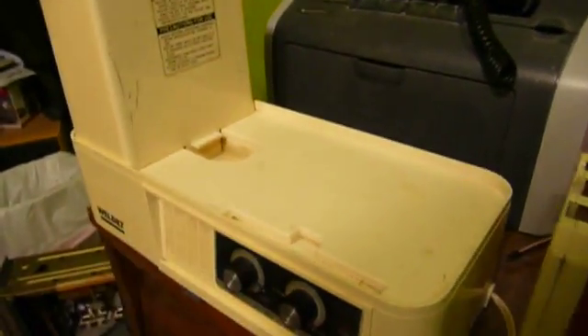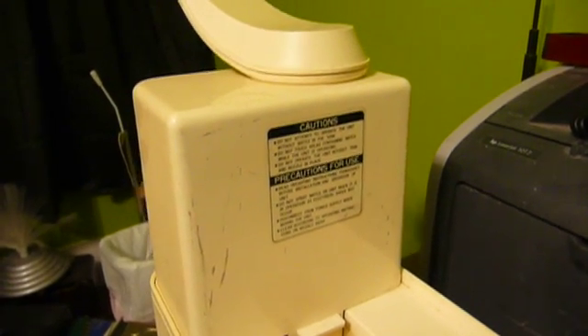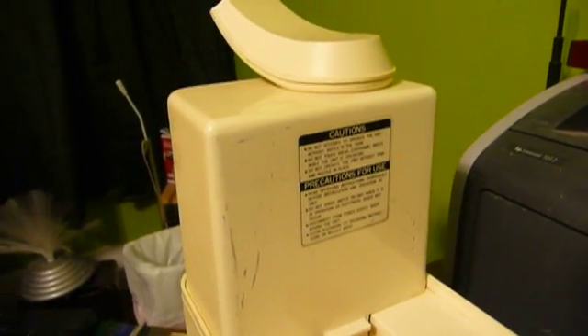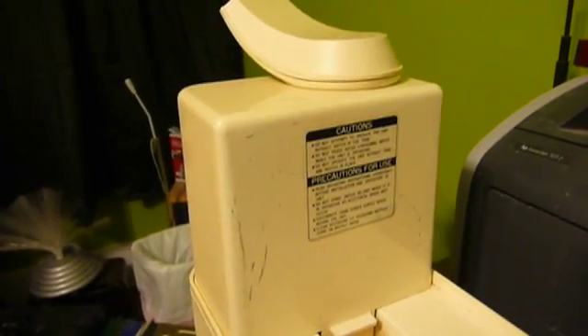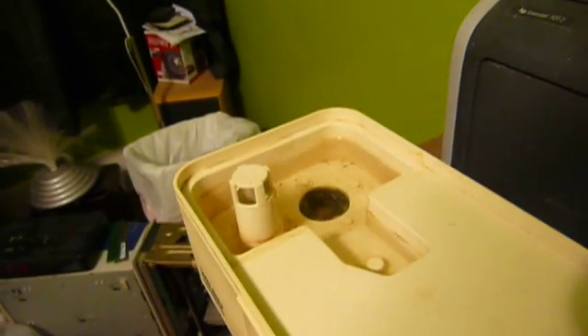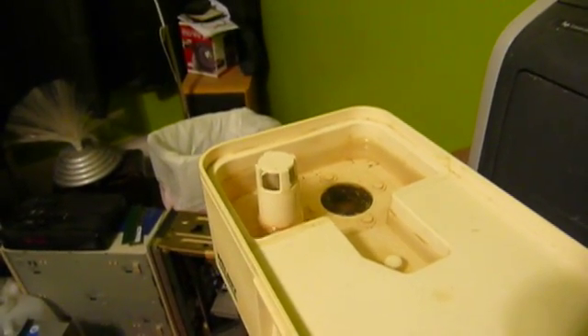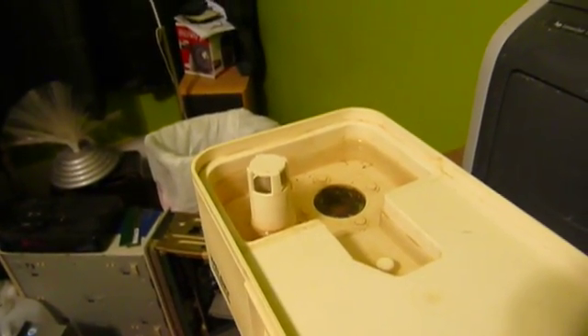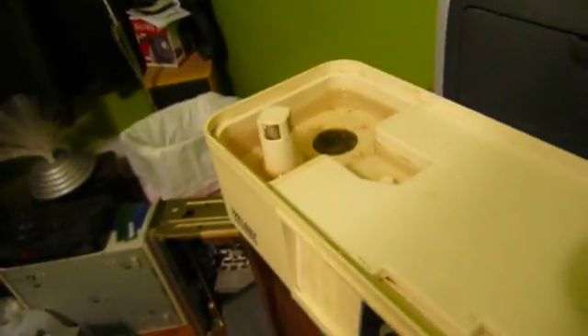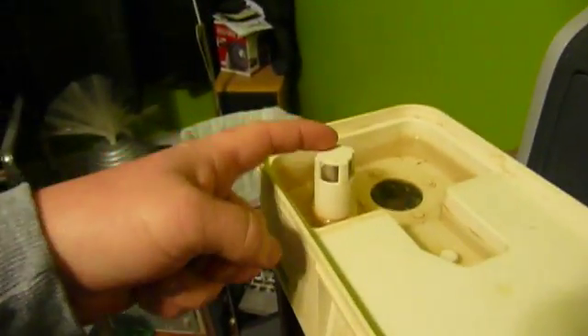The first thing is there's a basin of water that sits on it, which I've temporarily removed. There's a set of cautions on the nozzle: do not operate without water in the tank, do not touch areas containing water while the unit is operating, and do not operate without tank and nozzle in place. They're not kidding about at least one of those things. My parents used to have a Sunbeam version, and being the curious youngster I was, I put my finger right down in the ultrasonic transducer — and to put it bluntly, that hurt like hell. Basically, there is a high-frequency, high-voltage, high-current waveform being fed into that transducer.